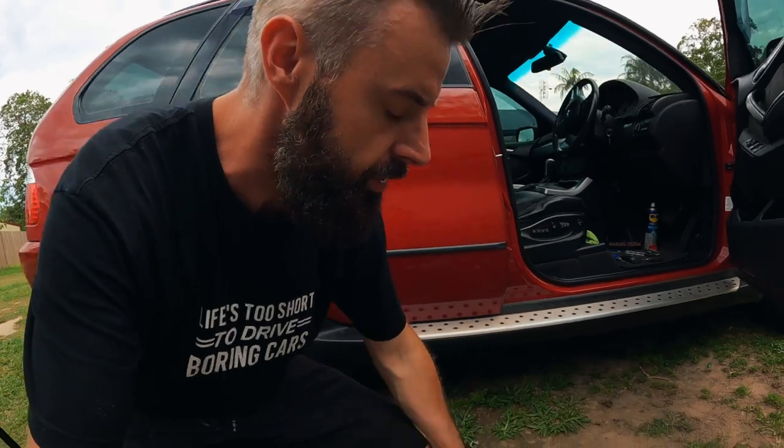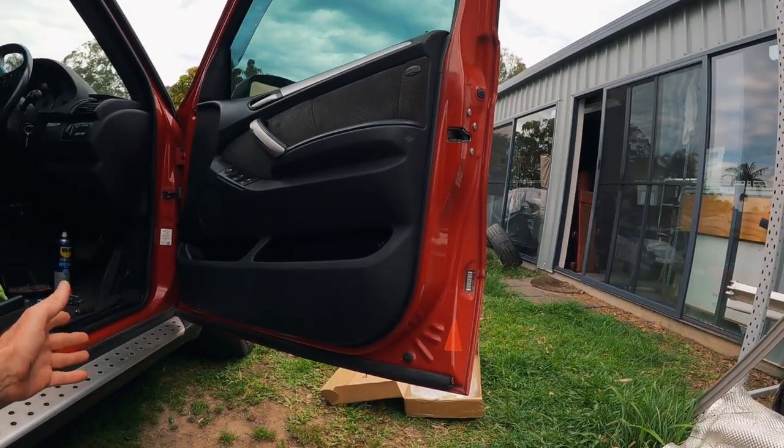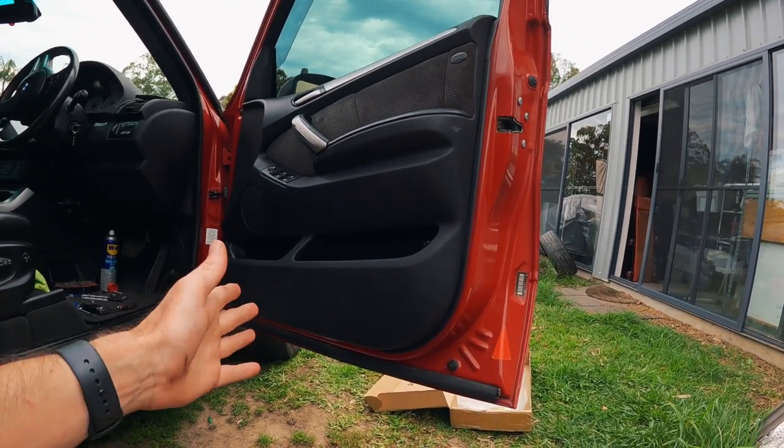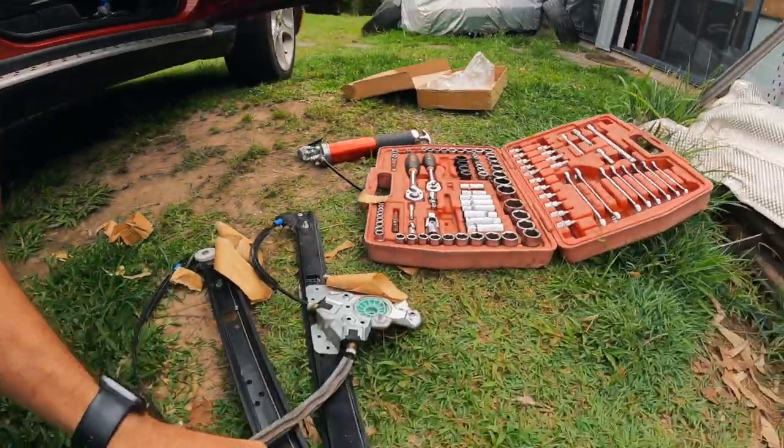So that's doing a window reg poorly on an E53. The big takeaway: door cards are easier to get off than I remember. I'd recommend doing that before you order parts — I thought I'd buy the reg and we'd be good, but I really need a proper vapor barrier, the proper clip for the glass instead of my homemade one, and we're also missing about 10 trim clips. If you're going to get an aftermarket regulator, check the length of the studs before you do anything. Out of all the cheap regs I've ever used, that's a huge design flaw. I'll blame the reg — that's what we do, right?